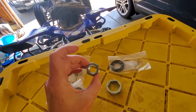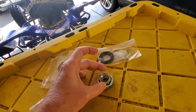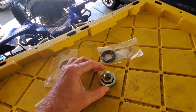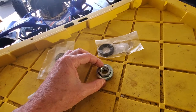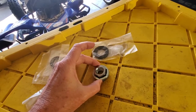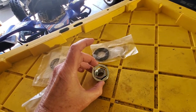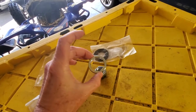There's a special tool you buy to stick in there, or what I did is went to the hardware store and bought a large nut. This nut here will fit inside, and I can hopefully get a wrench or a socket on it and twist. Unfortunately, this is the biggest nut I can find and it's a little bit too small. So I'm going to have to stick a washer on each side, but hopefully it's not super tight. That, or you're going to have to make something to get this out. You might be able to get in there with a screwdriver and a punch, but I hate doing that.